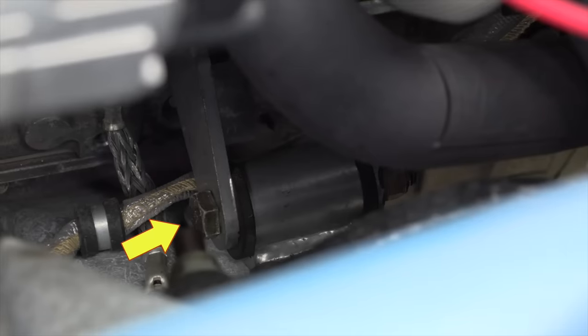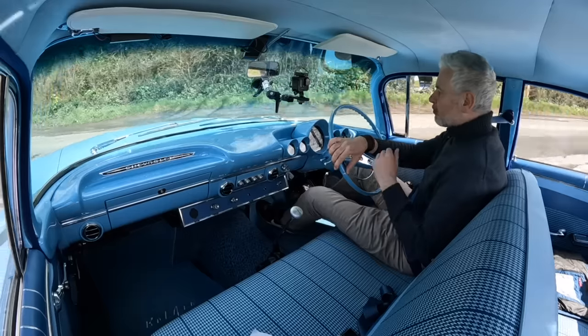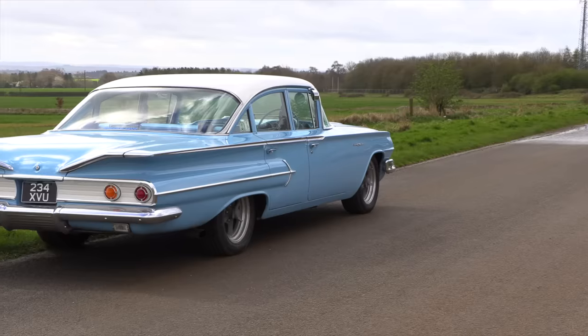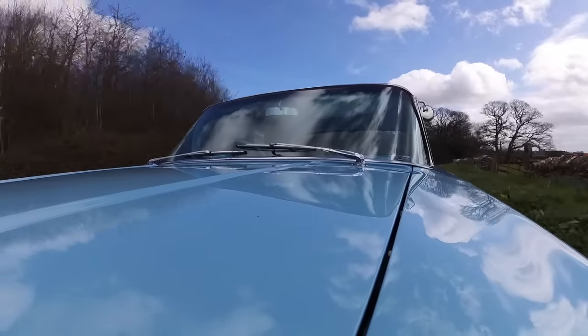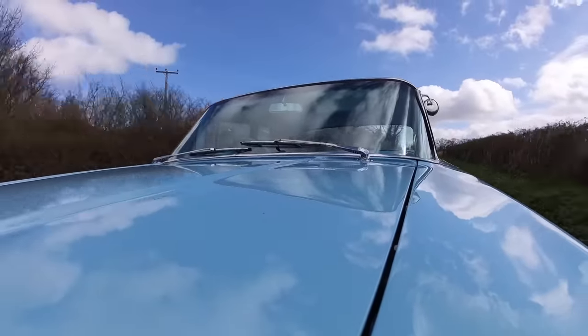The beauty of doing the conversion with this modern small block Chevy is that you really don't have to modify this car at all. All the mounting points from the new LS3 are the same as the previous small blocks used to be. Rob, who did the conversion, you do have to get some different mounts, but that's about it. I really do love these things. I think they look absolutely spectacular. You can buy a crate LS3 engine for about £9,000, and all in all, if you were to do it yourself, you could probably do a conversion like this for £15,000.